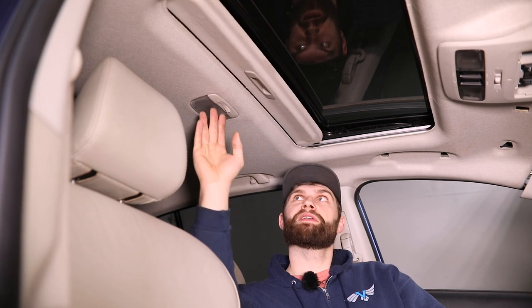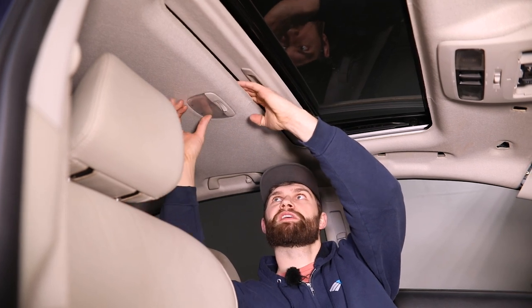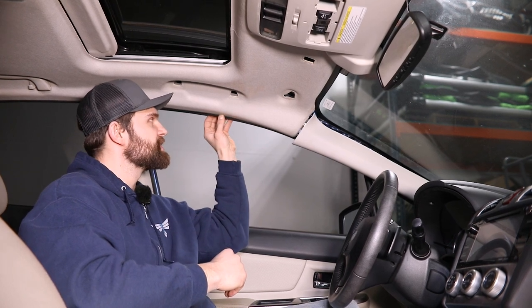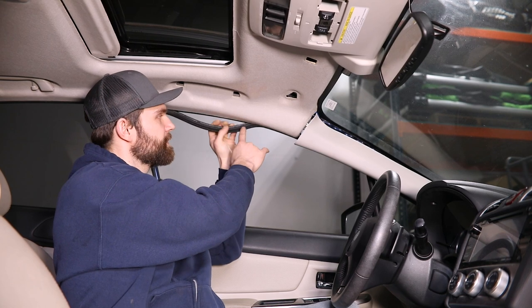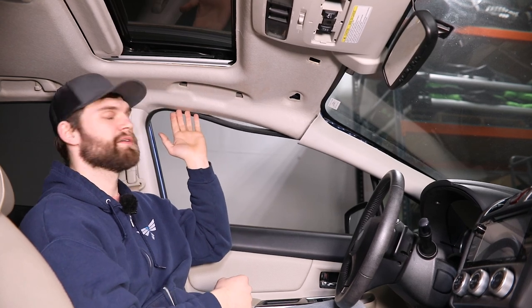For this dome light, there's just a clip up behind there holding that in. So once your trim's removed, get your hand over the top of here, reach back over the top of that dome light and just pull down with a little bit of firm pressure and that'll come down out of the way. Now the last thing you'll have to do up here in the front seat is you just need to partially remove this door seal. Just get an edge of it started and you can pull that down — you'll see how that just releases the edge of this headliner and lets it settle down a little bit.